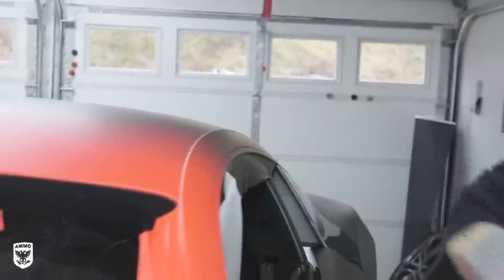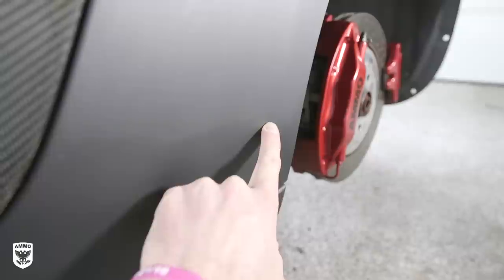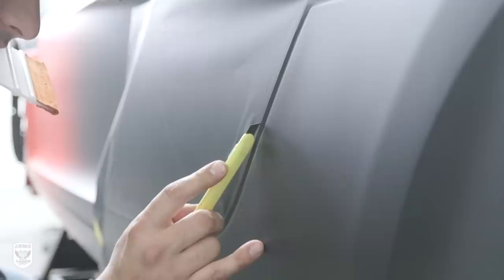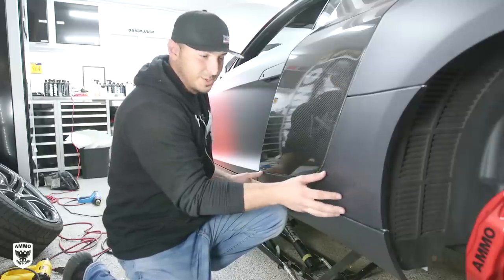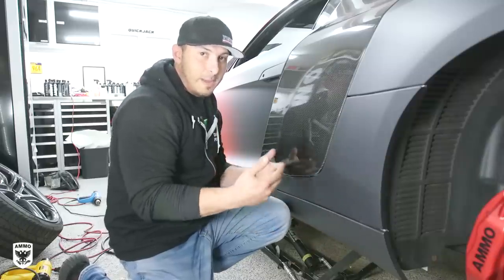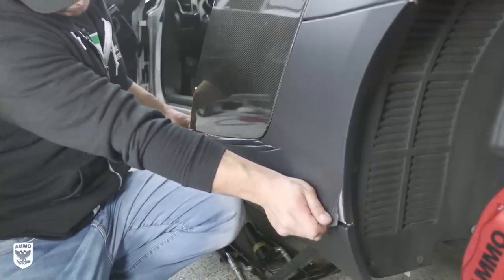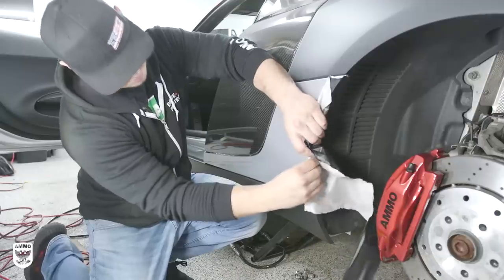After a few more hours, we noticed a difference in the matte finish halfway across the lower rear quarter panel — a diagonal shiny line from front to back. The panel had been cut a little too short, repositioned, and over-stretched when heating it to fit, which caused the matte surface to become shiny in that area. We didn't notice it until standing back and viewing it in different light. The fix: peel it off, put a new piece on, and redo it.